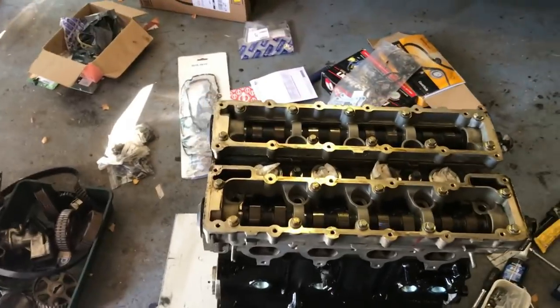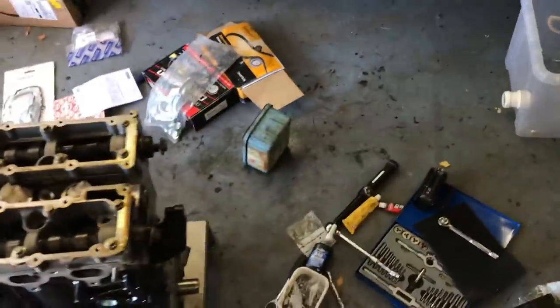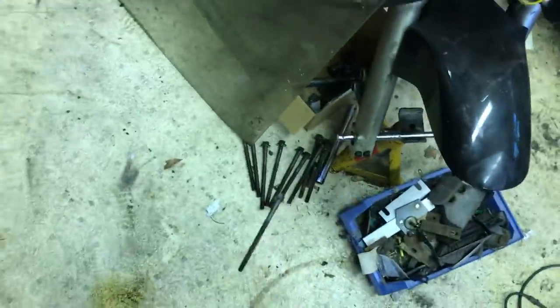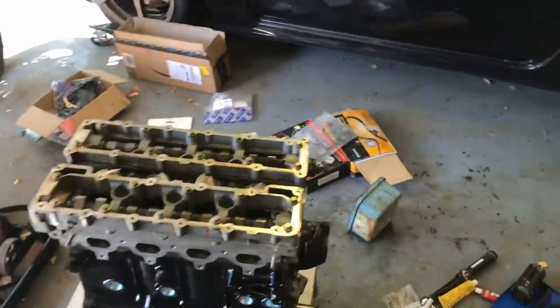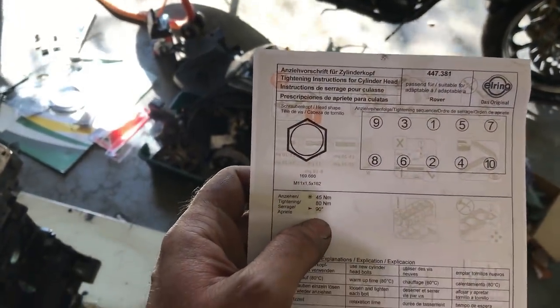The T16s, you get two different types of bolts, and they're all stretch bolts but the tightening regime for each is different. The original bolts are stamped in the heads — these are the original ones marked KX — and there's another different type. I think you do 45 newton metres on all of them, and then it's either 80 or 70 depending on which bolts you've got, and then a further 90 degrees. These aftermarket bolts aren't either the KX or the other Rover type, so I'm just going to follow the tightening regime that came with my kit. 80 is on the higher end anyway, so it ain't going to fall off.